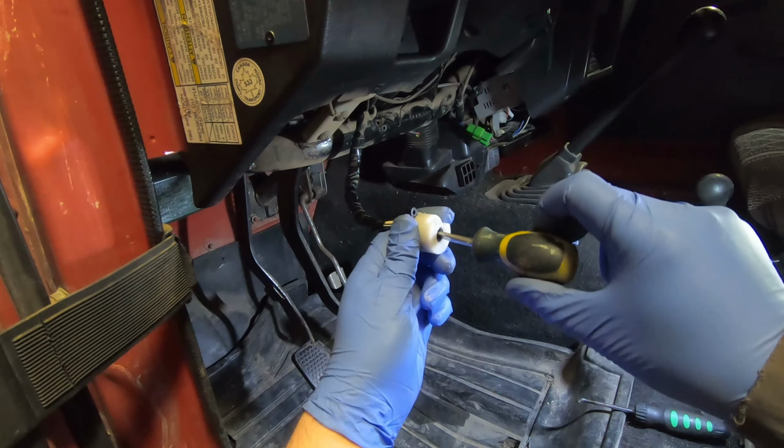Plate. What I'm going to do is essentially make a spring out of this silicone. So this is basically just a piece of silicone rubber that I've had lying around as spacers or whatever. So I'm going to carve this down into a donut, try to get the thickness about right. And the hope is that it'll provide kind of a constant even spring force across that whole disc. We'll see if that helps. So that's the new spring, and I might have to experiment with the thickness of it, but that seems to be okay.